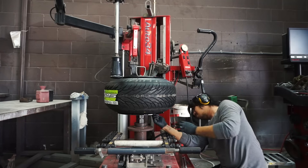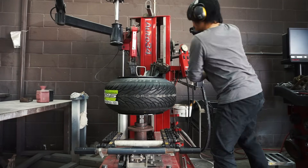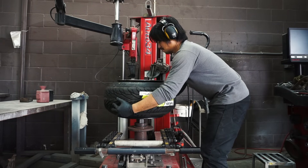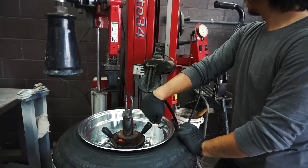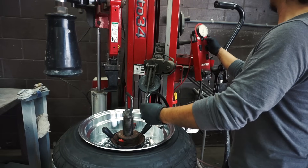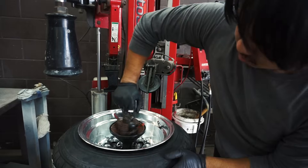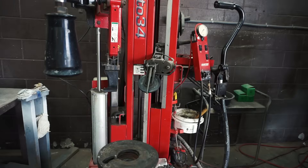I'll go ahead and set the tire pressure to 35-37 psi, which is higher than what the tire would normally run at 29 or 30. In normal conditions when a tire deflates, the bead stays seated because it fits perfectly on the rim. Stretched tires on the other hand will shrink and pull the bead right off, and there's no way you're going to fix that on the side of the road — unless you've got lighter fluid. So it's very important to go with a higher psi, not exceeding maximum, and to regularly monitor your tire pressure.